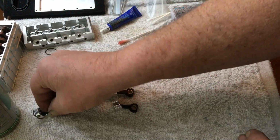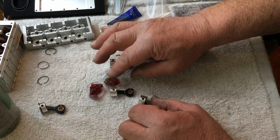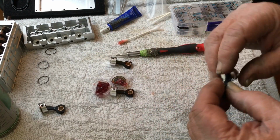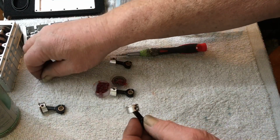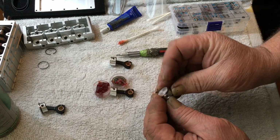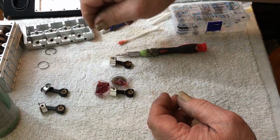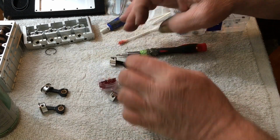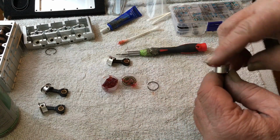Now this ring gap is very important. I'm going to show you how I do it according to the 2-stroke engines. If anybody's familiar with those, they have a specific area and a specific way they want you to put the ring gaps. So, okay, this is piston number 2. Okay. And we go to piston number 3. Doesn't matter which piston until you get the rings on them.